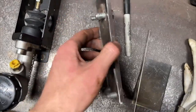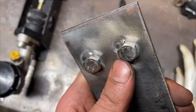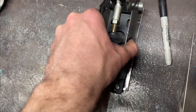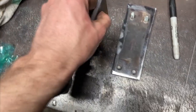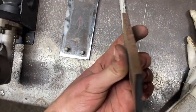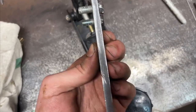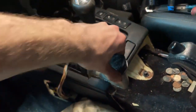Here it is all welded up — a couple welds on the bolts, and I marked the forward orientation. Clean up the edges — it's going to sit like this. Going to bolt it in. I also have this extra piece from a scrap piece of metal that's probably going to get welded underneath it as a support. Probably shorten it a little bit, mark it up in the car, and toss a couple tack welds to see how it's looking. Alright, there's the handbrake mounted — all good, not going anywhere.